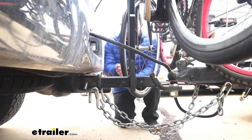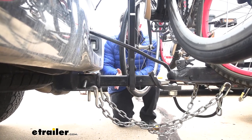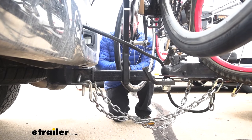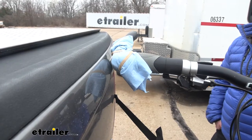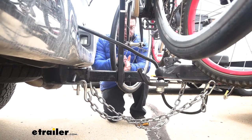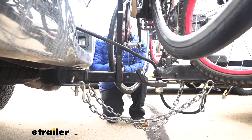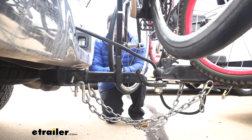One of the ways we were able to get this to work is having a longer ball mount. I think that's the key to making sure this is going to work with trailers and vehicles, because you have more room to adjust where the bike rack sits. Originally when we put it on there, we put it close to the vehicle thinking we'd need more of that space on the trailer side. But then the handlebars made contact and the bike rack almost made contact, so we realized it's too close. So we moved it further to the trailer because there's not much in the way on our trailer on this one — there's no toolbox or anything. Getting a longer ball mount gives you those options to adjust it either way, and you can definitely make sure it works.